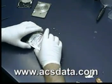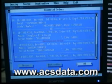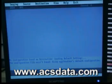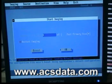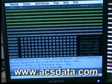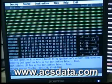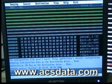We have our drive hooked up to our imaging station. We've already swapped the heads out and we're now going to start the imaging process. We'll start by powering up the drive and making sure there's no issues. The drive powered up normally and it detects — that's a good sign. It means our heads are at least working to the point where it allows the drive to calibrate. As the configuration data loads on to the destination, it looks like the drive is imaging. That is a successful head swap, and now we'll complete this process and recover the data.